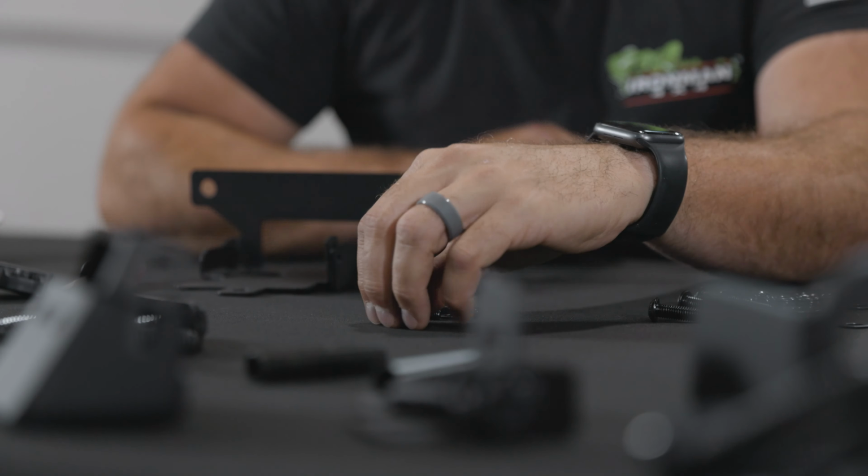And that is what was sitting behind here. So we'll get rid of this. We'll do the same thing on the other side. All right, we're gonna do this. It's a little tricky, but stick with me. This internal reinforcement bracket for the frame rails is stamped with an L for left-hand side. Orient it like that, these 2 slots forward, long slot up and down on the inside. It should look just like that going in.